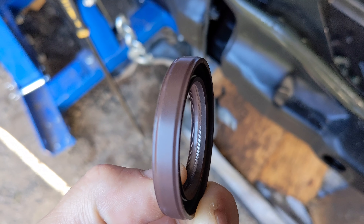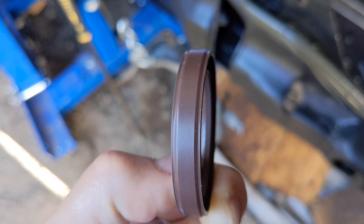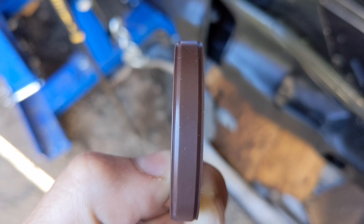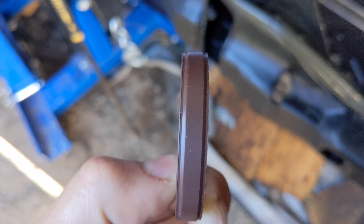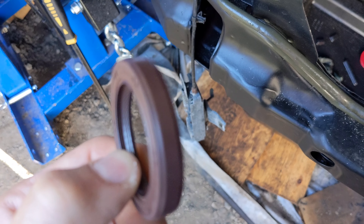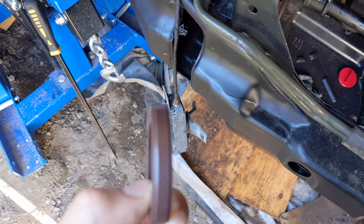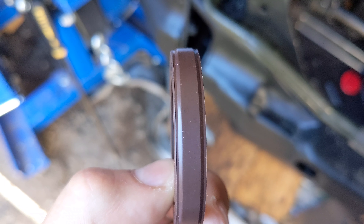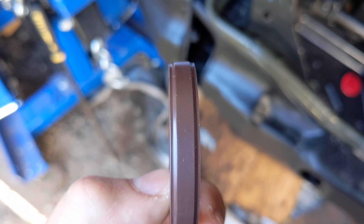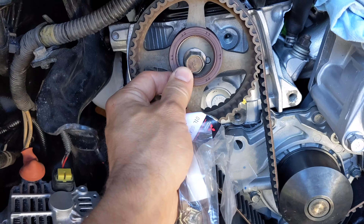The seals I bought are different from the ones still in the cam. I was told - or I read - that the bevel shape at the end is basically 0.5 millimeters. So right where that bevel ends, from the surface of the head, that's how much you push the seal in - just that little bit. Actually I think that's a millimeter, so half a millimeter is just the beginning of it. You need to measure it with a caliper anyway.